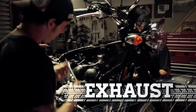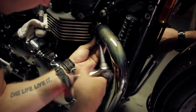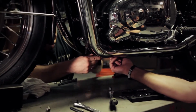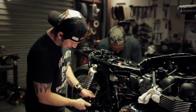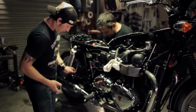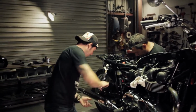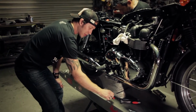I've got a swivel socket here that I'm going to use that's got a 13 right on it. It's easier to get in at the headers. Don't forget we've got to disconnect the sensors here. Yeah. So we just basically put this 12 on here, spin this peg bracket out. You've got to hold, remember, don't do what I did, because when you pull that nut off, all the crap falls out. You've got a washer, spacer, a big rubber grommet. We've got to save all that stuff because the exhaust kit uses all of it. So we'll set that aside over here.